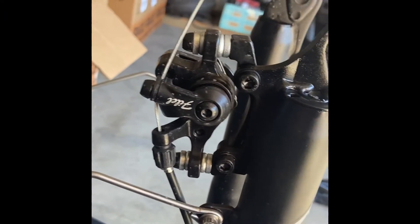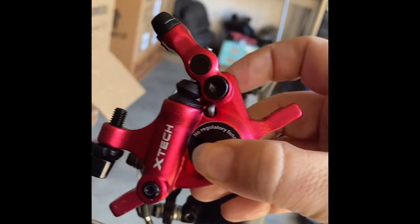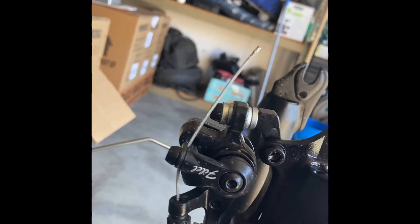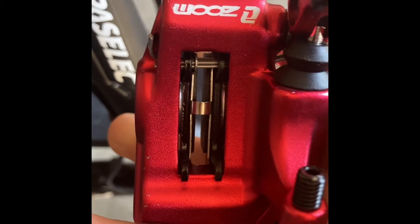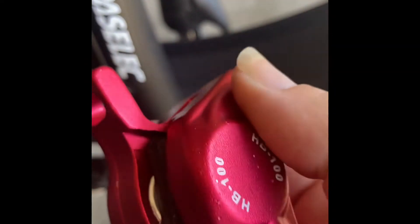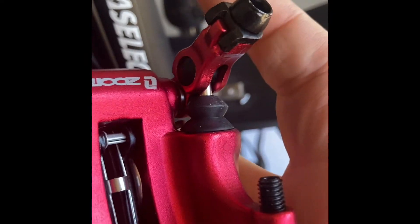This is how you take a mechanical brake to a hybrid hydraulic brake caliper. What this does is it changes your mechanical pull style — which has one piston pushing on one pad while the other pad is just on a wall — to a dual piston system that is hydraulically actuated internally and then pulled by a cable.